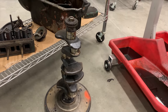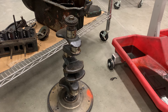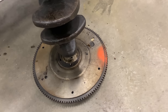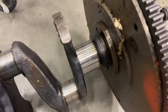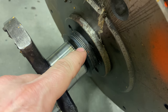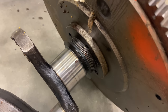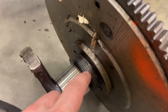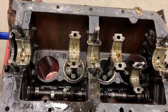Just a little side tip: you always want to store your crankshafts standing up. It puts a lot of stress on them if you lay them down sideways, so if you can, always stand them up or even better hang them up. One thing I did want to show you while I had the crankshaft out — a lot of people talk about British cars leaking oil. Well, most of them don't have a rear main seal. Most of them just have a scroll that is used to scroll the oil back that's coming out of the rear main bearing. So instead of a seal, you just have this little auger that brings the oil back into the engine — and that's why your British car leaks a lot.